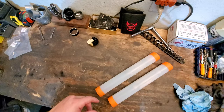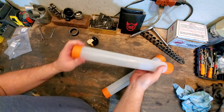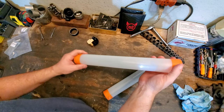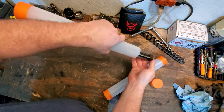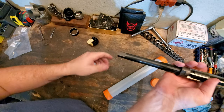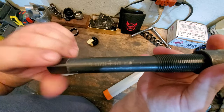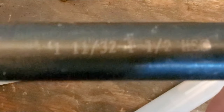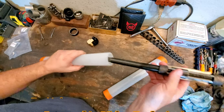Get back to that beam narrowing and a little bit of alignment coming up, right? All right. Okay, guys, these are the reamers, two that I got. When I was first going to be installing the polyurethane bushings, I understood that you had to ream those bad boys out, and I picked up a reamer to be able to do that as well. This is an adjustable reamer, and it has a size on it, and it tells you the adjustment range, and it works out really good.